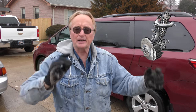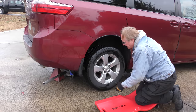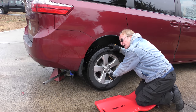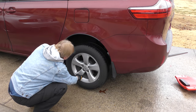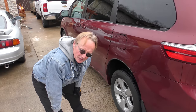So let's check the suspension. We'll jack it up and get a jack stand — safety first, we don't want to be squashed. Now first we'll check for suspension wear. We'll grab it here — does it have play back and forth? No. Then we check it at six o'clock and noon — no play. We spin it around; if the tire were out of round you'd see a lump as it goes around. So there doesn't seem to be anything physically wrong.